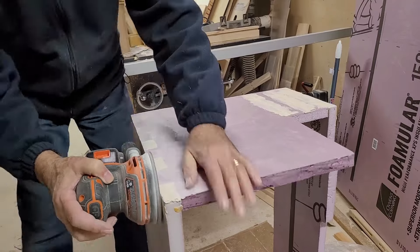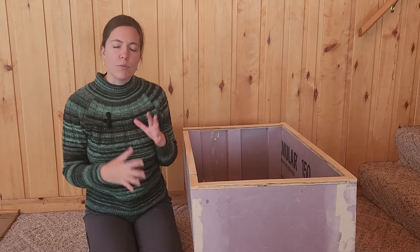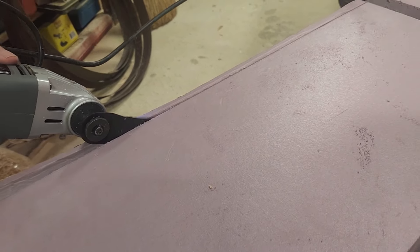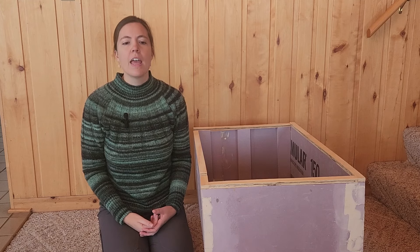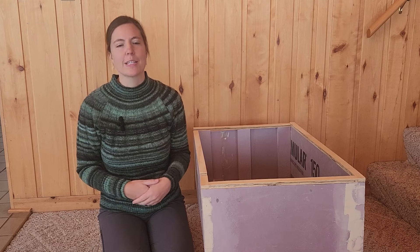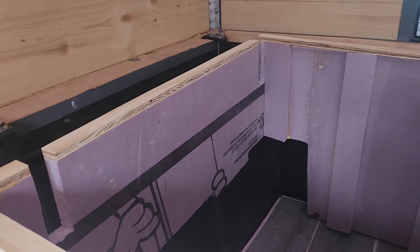I will be covering this in paneling and contact paper, but I wanted you to be able to see it before I do that — that's why I'm making this video before it's completely finalized, just so you can see the foam. I also had to do a little bit of straightening of the edges, and the oscillating multi-tool worked great again. The bottom actually needed a little bit of foam added back on because it was balancing a little wrong in the truck during the test fit. So I put a strip of foam on the corner that was a little bit low, then sanded it so it was level and smooth. After a few test fits — a lot of just making sure everything fit, hollowing out a few areas, making the mounting clamp areas a little bigger — we finally got it to a point where you can just slide it in.